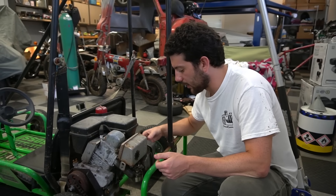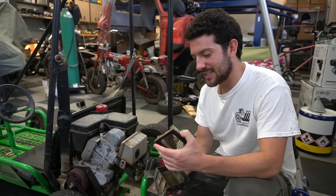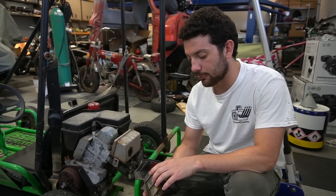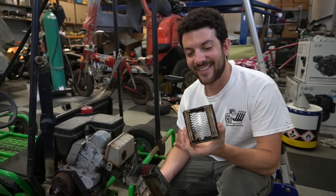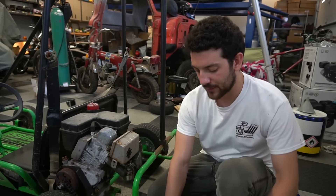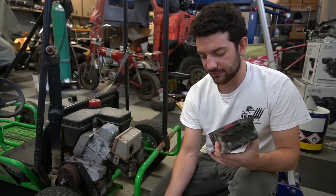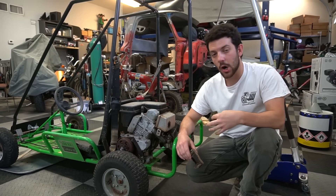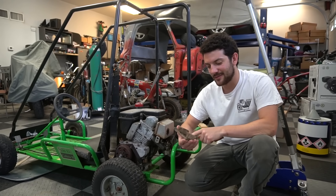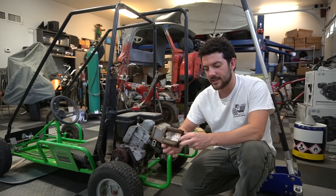While we're trying to find out why the cart was running so badly, we're going to show you guys the first free performance mod. Here is the air filter — the factory air box on a lot of these small engines can be really restrictive. What Ike did was remove three-quarters of the paper on this filter, so we have the foam here — other than that it's completely free-flowing. If you're trying to have a super reliable, long-lasting engine, this free mod probably isn't for you since it requires taking out half the filter.